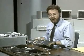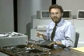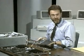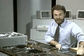Now, it's also not unusual to see a motherboard today that has room for 8 megabytes of memory, but that expands to 16. That computer will probably expand to 16 megabytes with the addition of the special board that goes into that special high-speed slot. Now, with some computers, all the memory goes on that board. With others, the extra 8 megabytes or more goes on that expansion board.